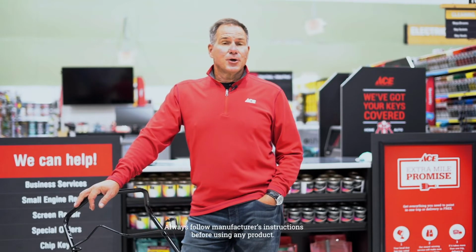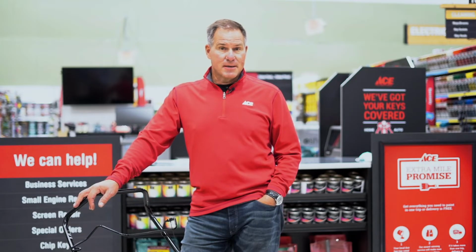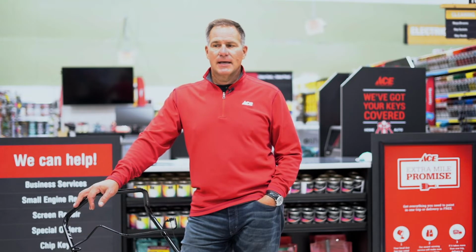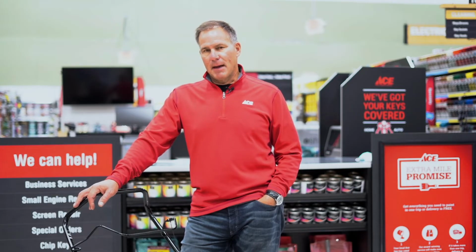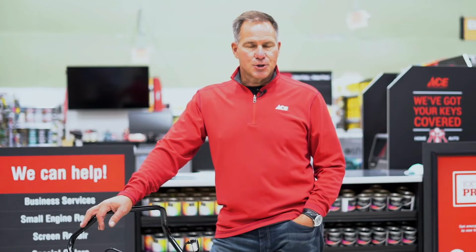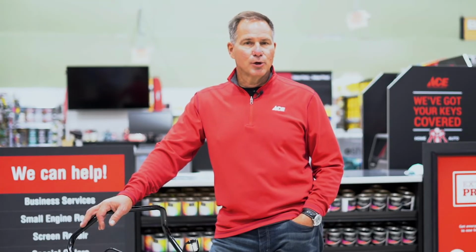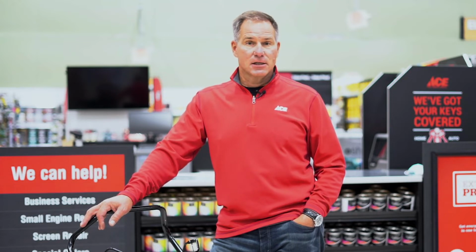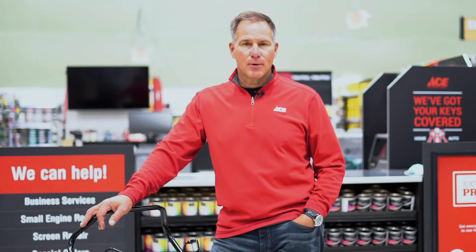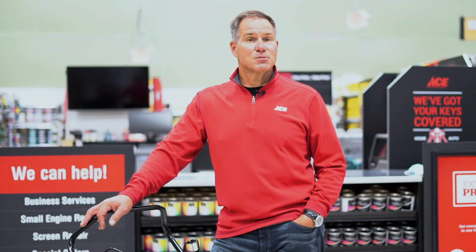While it's always a good idea to use a fuel stabilizer when you put your snow thrower to bed in the spring and summer, if you didn't do so, it might be wise to use a fuel treatment before you start it up. I'm going to show you a product called Seafoam, which is an additive that you put in the fuel tank along with fresh gasoline to help clean out the carburetor and the injector and to try and get the unit to run at its peak efficiency.